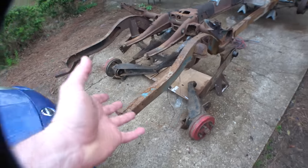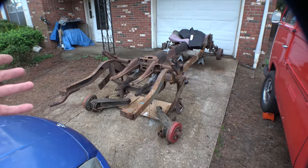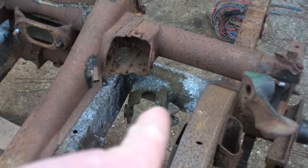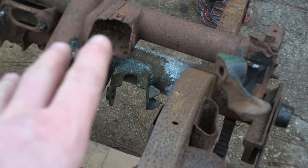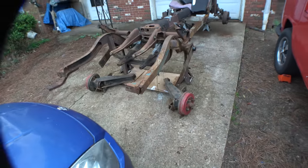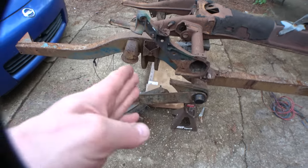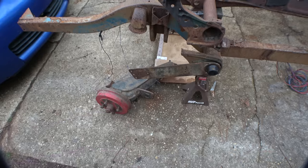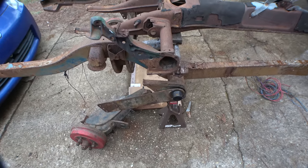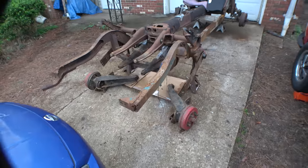Anyway, yes, we have trailing arms for my 1967 Volkswagen bus frame that we're doing the IRS conversion to. There's the pockets that we welded in. It poured rain the other day and they started to just barely flash rust, but nothing a little bit of acid couldn't take care of. There's the arms. I'm going to have to make these spring plates match, which isn't a big deal — just cut them short and redrill new holes in them so that way they match up with the beetle ones. I have a set of beetle spring plates in the back that I can use as a template to align the holes properly.